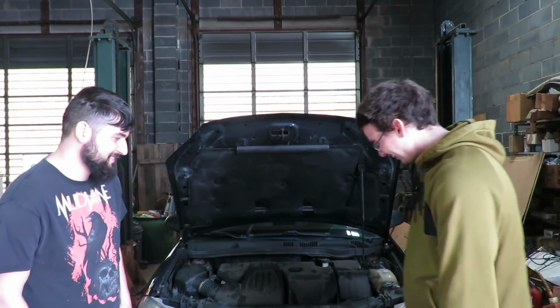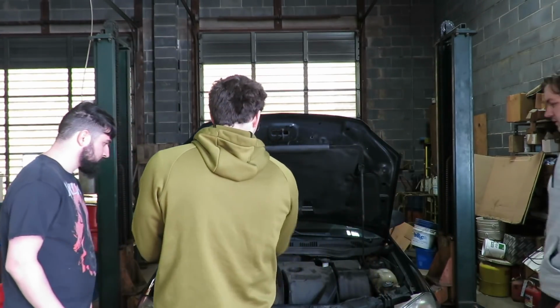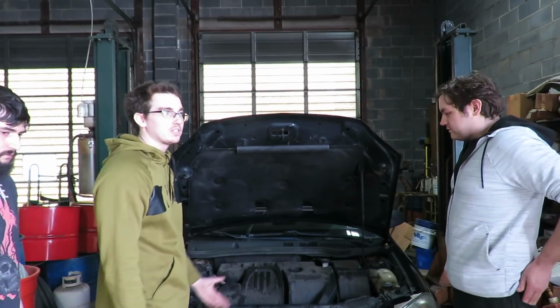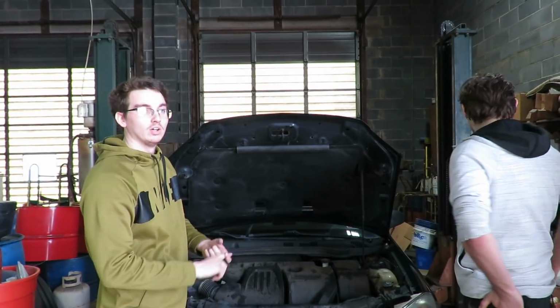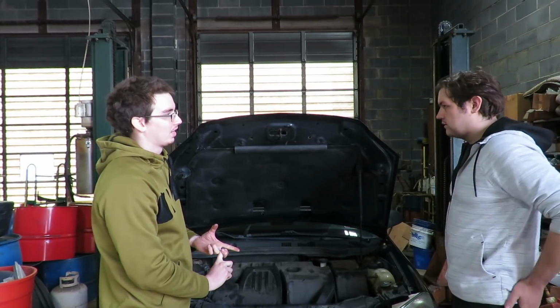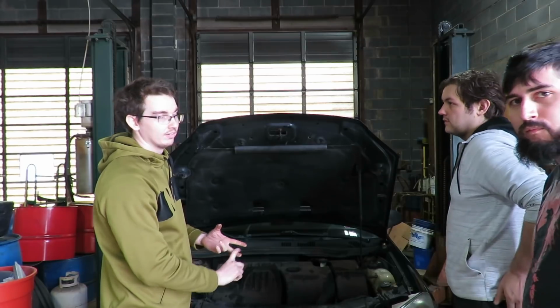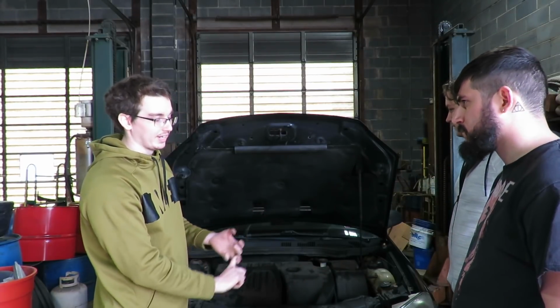Alright, new video. Hey guys, this is Tom on the spot. Alright, basic maintenance includes oils and filters. So oil change, obviously, get it done every 3,000 miles depending on what oil you get. 3,000 miles for conventional, 5,000 for synthetic blend, 7,000 to 10,000 for full synthetic.